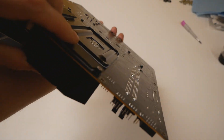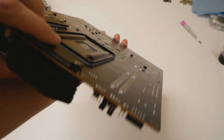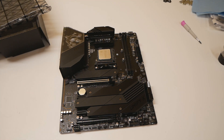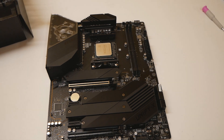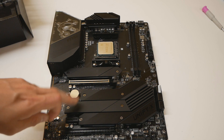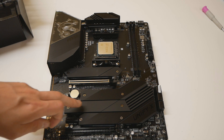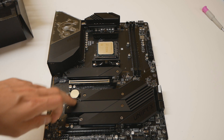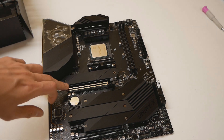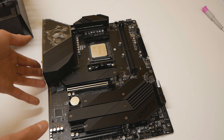The additional MOSFET heatsink is on the back side of the board. The memory slots are not SMD. Here's how the motherboard looks in a relatively close view. These should be the M.2 ports — the longest one is over here, and that should be an M.2 port as well. We only have two X16 slots, and the bottom one is X4, so no SLI sadly.